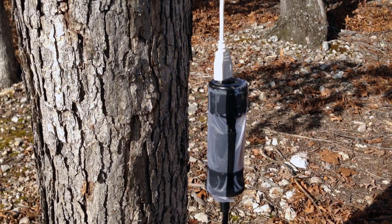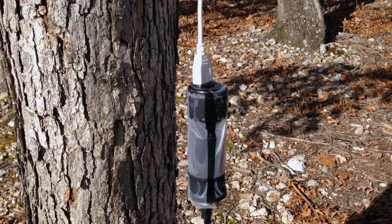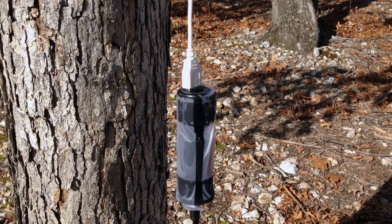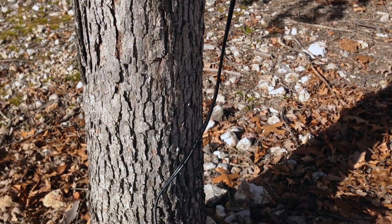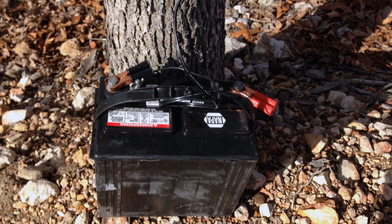These chargers come in different amperage ratings. This one is a half amp charger and it's not really powerful enough. You really should get one that has a full one amp to each USB port. That's plugged into a 12-volt adapter, and the other end of that is just alligator clips to a battery, which gives you a ton of capacity.